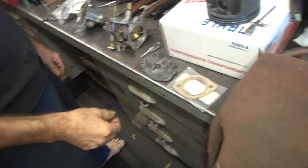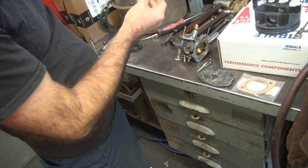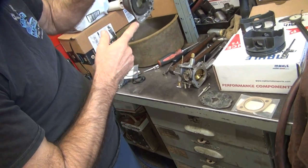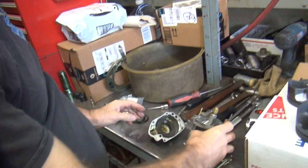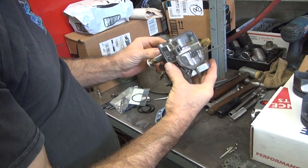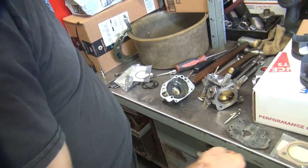So how long are you going to work on your bike out in the street? It still doesn't run? Well, you took the carb off. I had to because it's all screwed up. So the float appears to be a little high. You had to have the choke on because the carb had an air leak so bad. And then I made it run without the choke on — you said it couldn't be done.